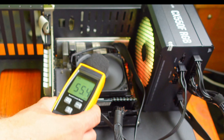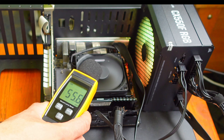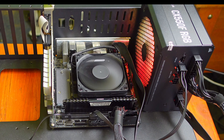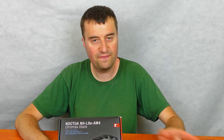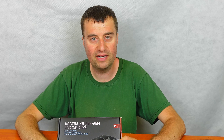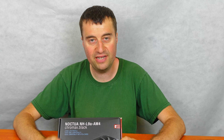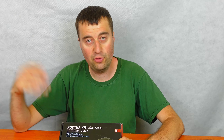It was a little bit louder under load obviously, but overall it did its job and it's good enough. The only thing I would say is that if you're using this on an ITX board, be a little bit careful if you are using an M.2 drive, because the M.2 drive is very close to the CPU socket. I'd probably suggest an SSD instead. Because even on my open test bench, a lot of heat was being created around the CPU area — and sometimes when using the M.2, this would increase the CPU temperature up to about 65 or even 70 degrees idle, which then under load could easily hit 95 degrees or even a bit higher.